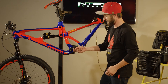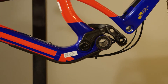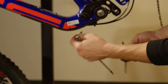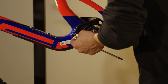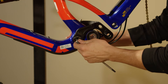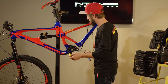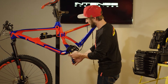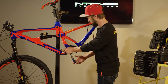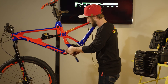Take our shoulder bolt and our 5mm Y-wrench, and get the shoulder bolt started on the drive side. Then take the Y-wrench and continue tightening the bolt. This particular bolt we will torque to 20Nm. Taking our torque wrench and our 5mm Allen key, using the torque wrench on the shoulder bolt side located on the drive side of the bike, hold the non-drive pivot axle with the Y-wrench and torque it to 20Nm — give it two clicks, that's all you need.